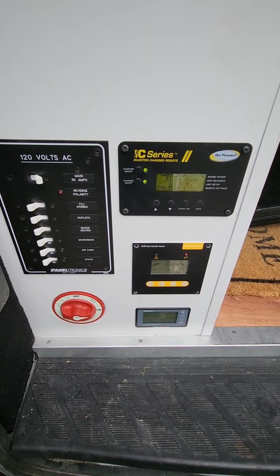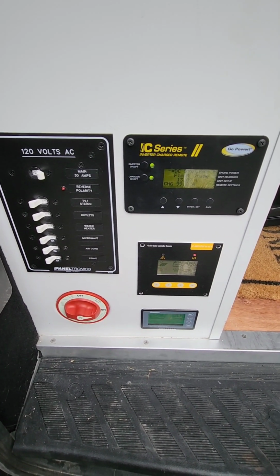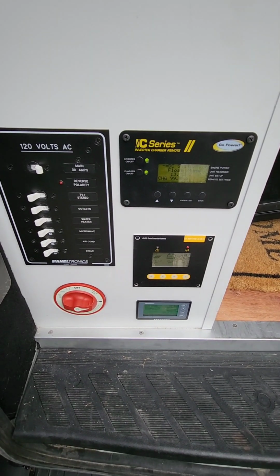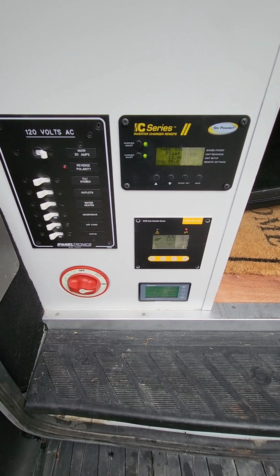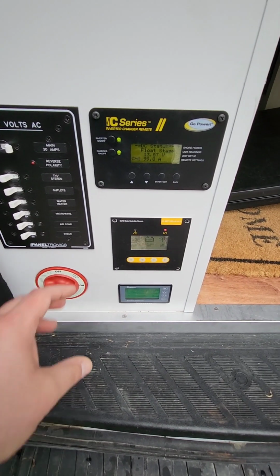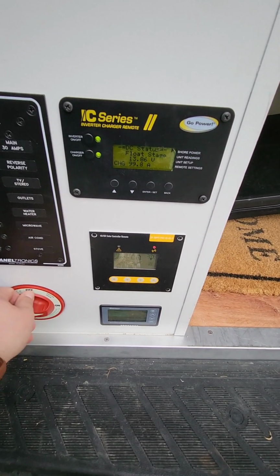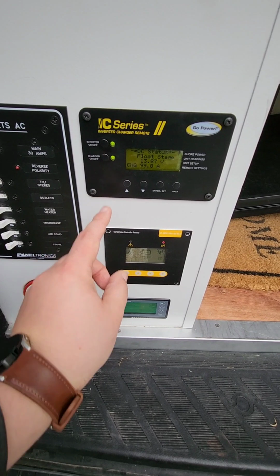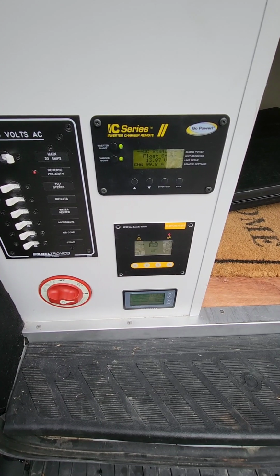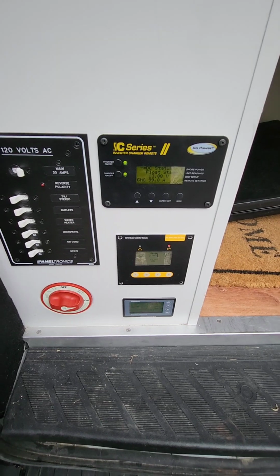The one scenario where I really highly recommend and hope that you turn off everything, so this to off, make sure this doesn't have any power on it, is if you're going to be leaving the van for longer than like 30 minutes, right, an hour. Say you're going out for an 8-hour hike or a 4-hour hike during the day, I would go ahead and turn absolutely everything off, right? And that'll just help make sure, especially if the sun isn't shining or we've got a really cloudy, rainy day, that we're not draining the battery so that we have charge when we need it.